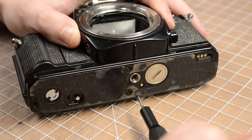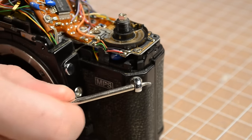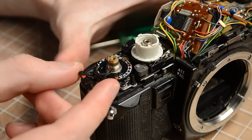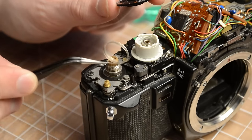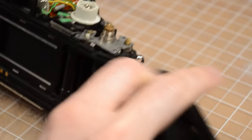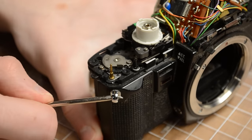Removing the four screws on the base plate reveals a nice big area of corrosion around the tripod mount to the left of the battery tray. The fact that the camera is still working is a good sign, but it doesn't really bode well for the rest of the internals. My guess is that somebody set this camera down in an area of standing water. Loosening the top flex PCB to get at the prism requires a little bit of order of operations because we need to free the shutter speed assembly as well as the frame counter and advance assembly before we can get at the strap lug to remove the plastic shell, which removes the plastic shroud around the lens mount, allowing us to access the wires soldered to the resistor band for the aperture. On top of all that, we have to desolder even more wires to get it lifted out of position. I guess this is why people don't really like working on these cameras.